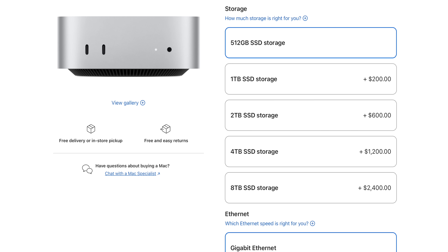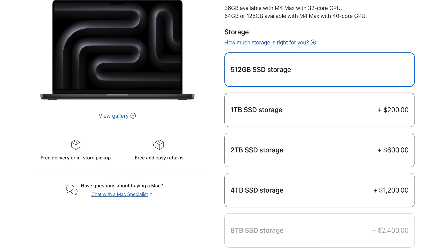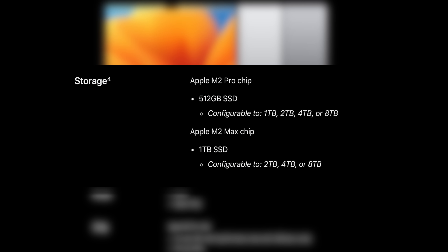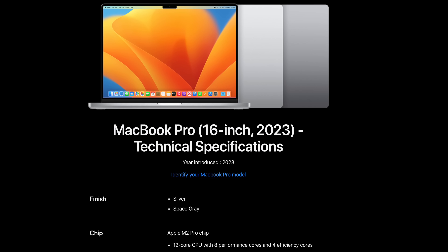But you might be noticing something a little wacky going on here: the M4 Pro Mac Mini can be configured with eight terabytes of storage, but the M4 Pro MacBook Pro can't. And the thing is, that didn't used to be the case. In the past, the M1 Pro and M2 Pro could go up to eight terabytes with eight NAND modules — in fact, those machines used eight NAND modules for the four terabyte configuration as well. If this is starting to get confusing, you're not alone, because there's some weird stuff going on in the background that we can really only speculate about.